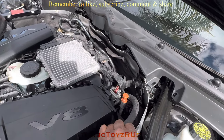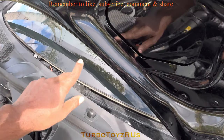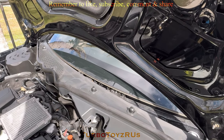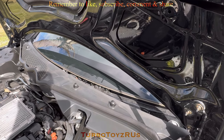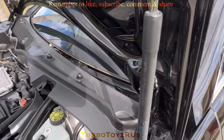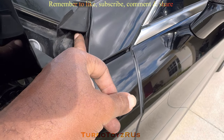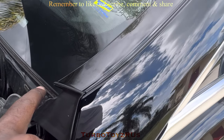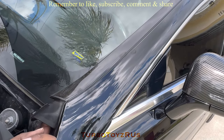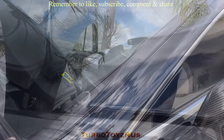After freeing up this firewall, you are going to take this part here off. You remove both wipers. This car here, the wipers never came off — I had to soak it a little bit with WD-40 and then give it a little pull to get it off. To get this cover off, it goes up underneath here and hooks right in this groove right here, so you're going to want to put your finger up under there.